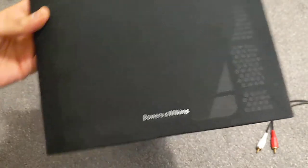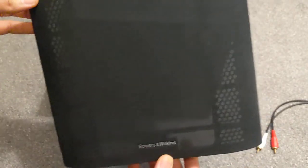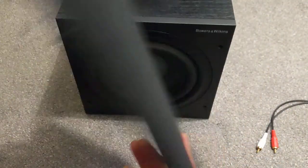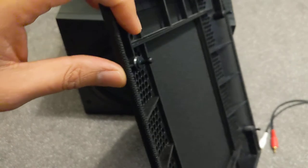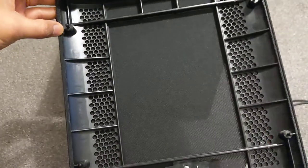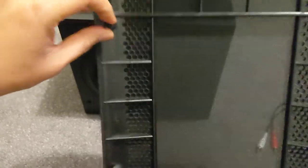We're going to do a very quick overview and maybe give you a quick bass test to give you an idea of what this subwoofer is capable of. The grille has quite a sheer fabric on the front and you can see the mesh framework from the light — the center is quite empty with drill holes on the edge. The pins are a very breakable little plastic pin, not like the solid steel magnetic construction you'll see from the likes of SVS. For a B&W premium product, I would have thought there'd be a bit more thought put into the design of the grille clips.